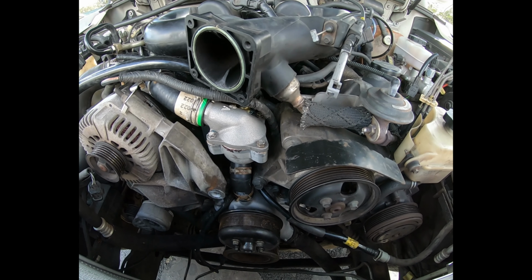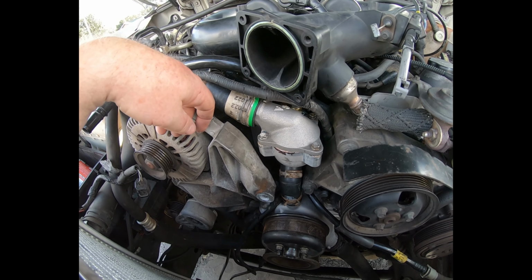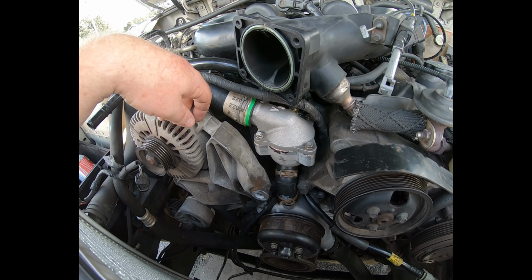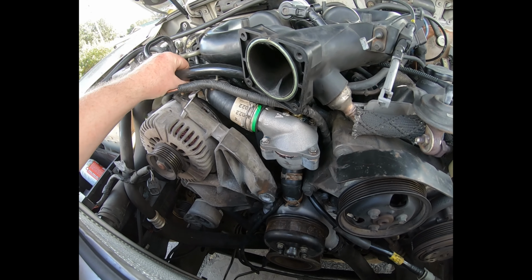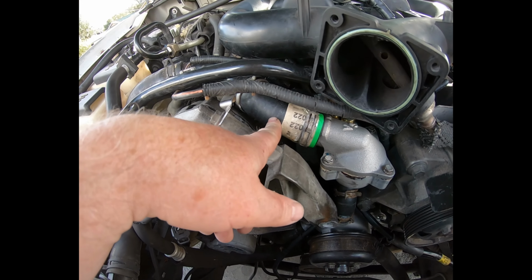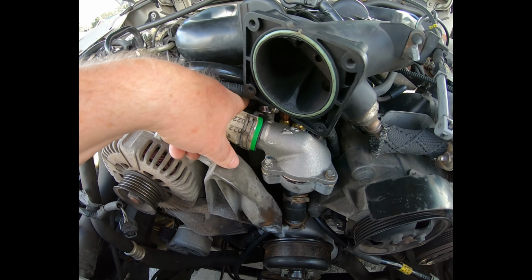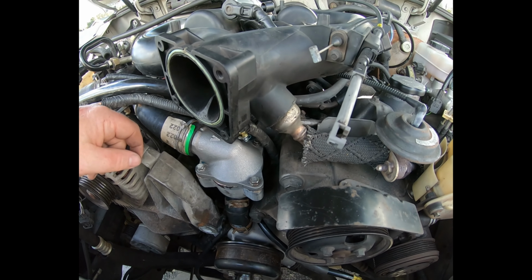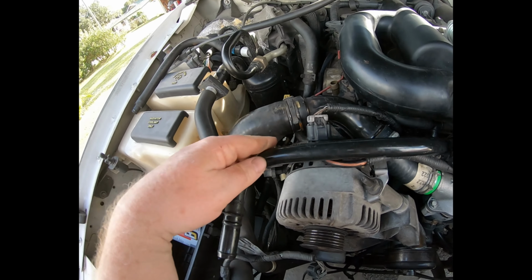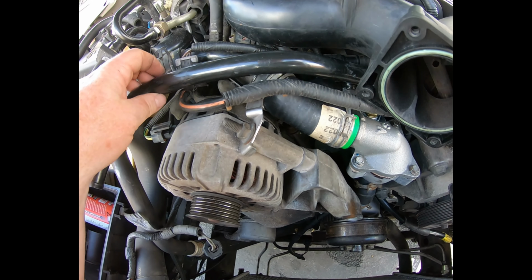Okay, second time worked as planned. The bolts went in quite normally. I did put a little bit of Loctite on there again after I had cleaned everything up. Everything bolted on quite the way it should. So far I've got the upper radiator hose on, I've got the heater hose on, sensors, of course, all the electrical wiring there, the bypass hose, and reconnected the alternator here, plugged in the little plastic divot there, little spike.